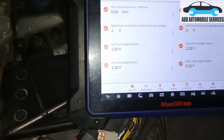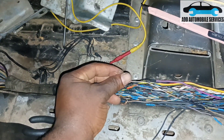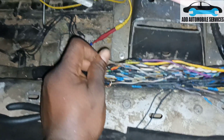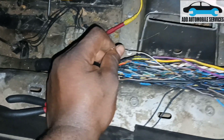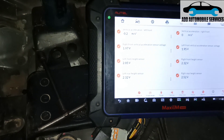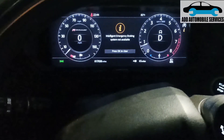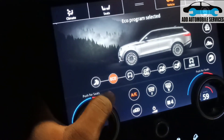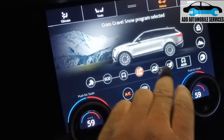One wire pulls the voltage up and the other pulls it down. Now that I've found the error — the mistake from the previous repair — I'll rejoin the wires, pack everything, tape everything, and go for a test drive to see if it will still remain at eco, or move from eco. You can see I'm getting the right voltage after swapping the wires. I can now switch the mode to eco or to dynamic or to any of them and it's working.